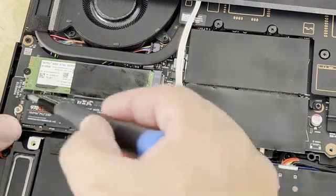We need to move that free space to be adjacent to the C drive, so we'll use another tool. Open Google and search for GParted. This is a bit of a déjà vu — we'll download the GParted ISO and use Rufus to create a bootable USB drive from it. We can reuse the same USB stick we used for Clonezilla since we don't need it anymore. Plug the USB key back in.